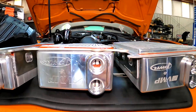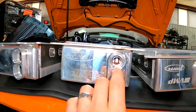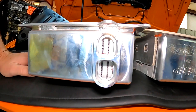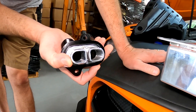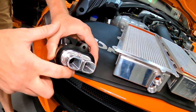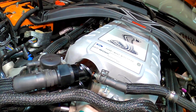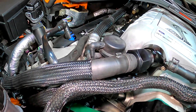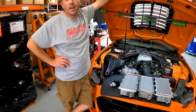One thing guys are going to point out: you can see the raised lip inside the factory version. There's no point in knocking it out more than the diameter of your tube going into it — that's what that raised lip is. But if you look at the D-port design, the lip on this one is much smaller because the wall is thinner on the piece they're making out of billet aluminum. They fit perfectly and there's an O-ring seal, so it seals up nicely against the face. It's a great looking piece — nice billet aluminum — and I like the modularity. If a guy wants to run the factory lines for a while he can, then upgrade his fittings and go to larger lines.